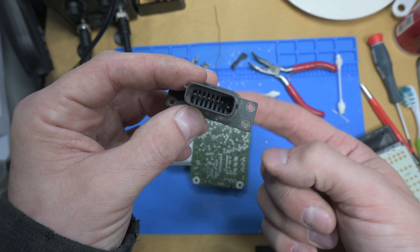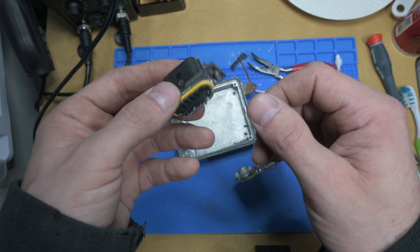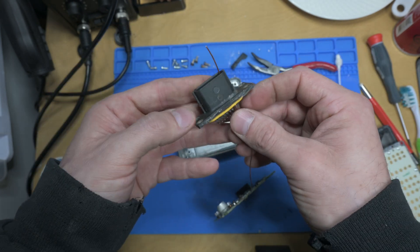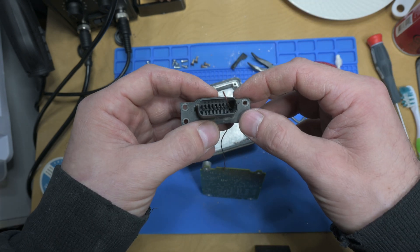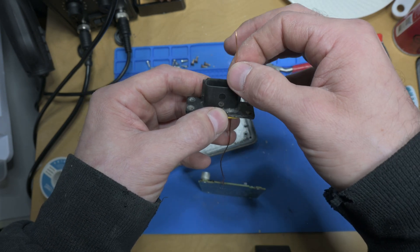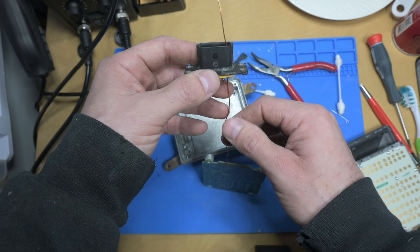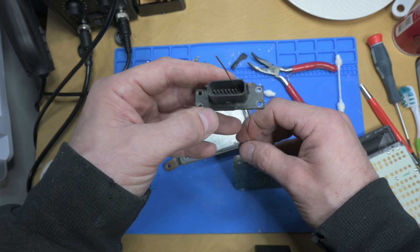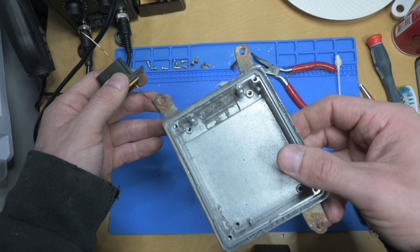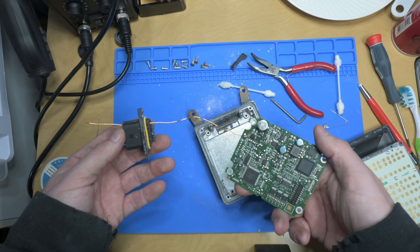So I think what I'm going to end up doing — the connector on the vehicle side of this was quite damaged as well — I'm probably just going to run my wire through the connector and instead of going pin to pin, I'll cut out the old pin and join this wire directly to the wire on the other side of the connector, then weather pack and seal that all up. There is a chance, albeit probably slim, that I may have just saved this module. So I'm going to bead blast the remaining corrosion out of these so everything seals up nicely, seal it up with some dielectric grease to hopefully protect it a little bit longer, get this put back in the vehicle, and see if it works.